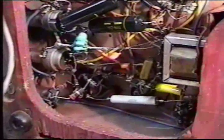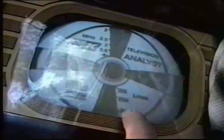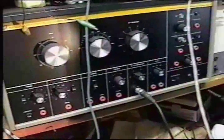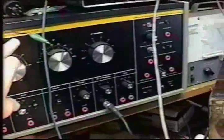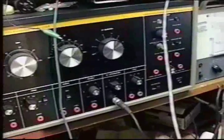That is 6,000 volts right there. That's not very much by today's television standards, but on these sets 6,000 volts was quite common, and they were more dangerous to work on than the newer ones. Here's what I have for a picture so far on my test pattern, as you can see. I am feeding that test pattern with my B&K 1077 Television Analyst, which I acquired not too long ago at a very reasonable price.